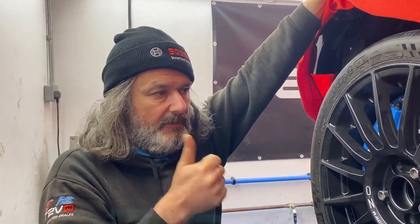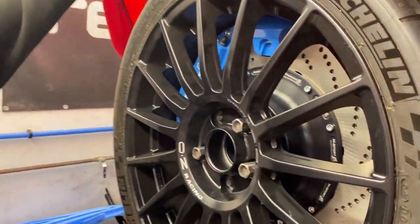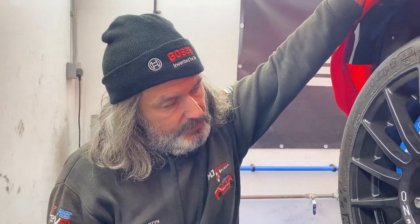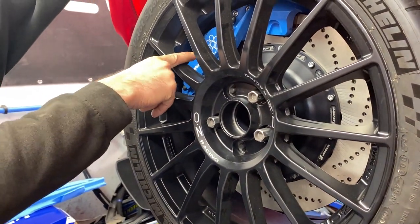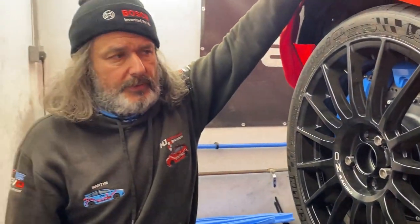This is RS size on the market - Focus RS can't run a 400 on the front because you can't get that inside an 18-inch wheel. 380 you can, just - let me see how close that is. It's weird on camera because it doesn't give you a full perspective - when you see it in person you think it looks bigger than it does on camera, because it is. These calipers are not going to be blue by the way - these are just test fit ones. That just gives you an idea, and I think the front caliper - well it's not messing around.